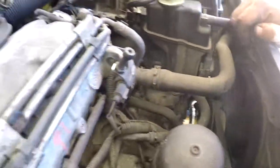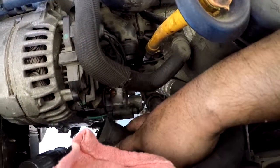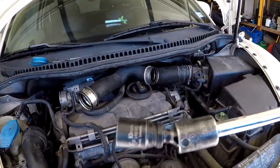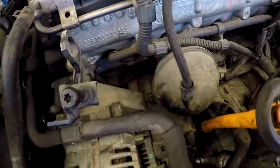It's a little hot out today. I took out the lower radiator hose — it's located on the driver's side — and drained the system. Then I loosened up the hose that came up to the thermostat housing, took it off and brought it out of the way. There are two 10-millimeter bolts: one on top and one on the very bottom. To get to the bottom bolt I used a quarter-inch ratchet with an extension and a swivel, and I made sure to use a magnetic socket so I wouldn't drop the bolt.